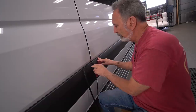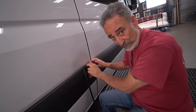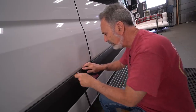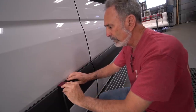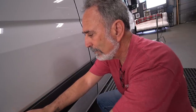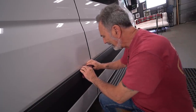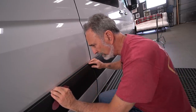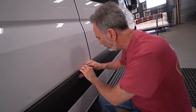Some of these black body panels are looser than others. What I have found — and I have not refined my system yet — is if you get yourself a dash tool and you softly, gently pry this top edge away from the body as you're putting in the rubber. Okay, this is really just the first pass, but already you can see how it goes in pretty nice. Now you've got to come back and press it in further, make it nice and even. You can feel as you go along there will be bumps where it's not in, so it requires a little finesse.